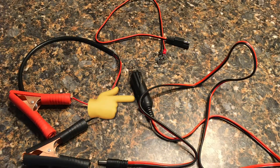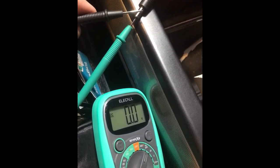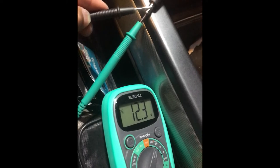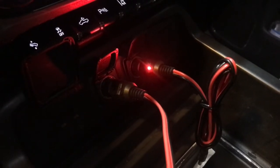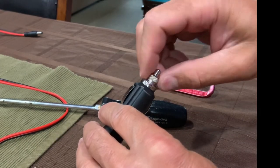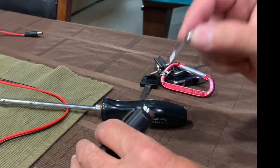The third option is a cigarette lighter adapter to plug into your dash. If you go this route, you want to verify that your cigarette lighter is on a constant battery supply and not a key-on power. A lot of these cigarette lighter adapters have an LED light on them — you can see the LED is on and I do not have the key in the ignition. If the adapter doesn't have an LED, you can plug it in and check voltage with a voltmeter to see if you have 12 volts with the key out. You can also blow a fuse in one of these; just unthread the tip of the adapter, replace the blown fuse, and thread it back in.